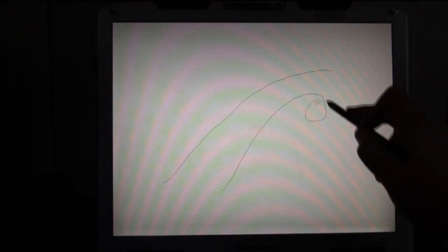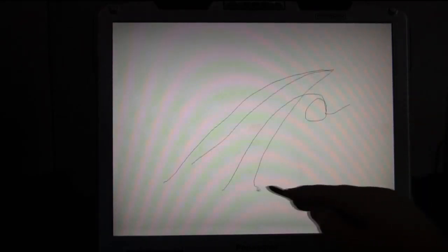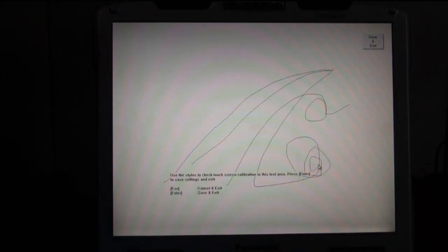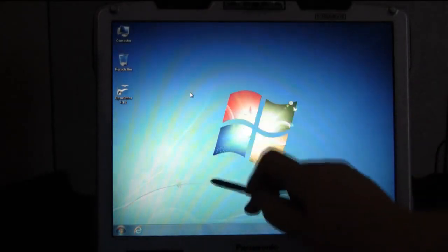That spot was just giving me a little bit of trouble. After you go through all the crosshairs — which I just finished doing — hit Enter. This gives you a screen where you can test the calibration before you actually save the settings. It's actually pretty well where we need it to be. Then you just hit Enter to save and exit, and now your touchscreen is calibrated.